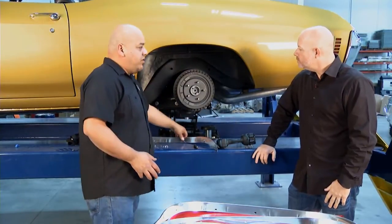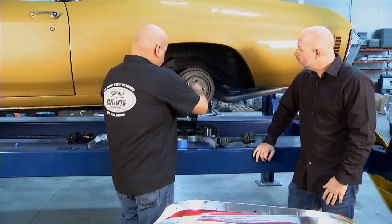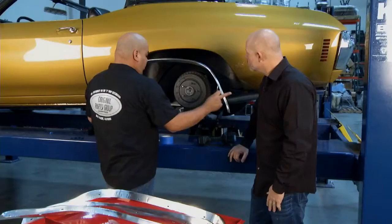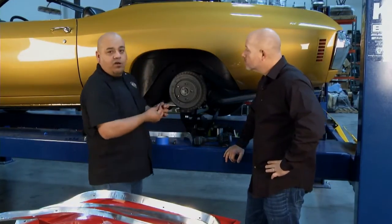First thing you want to do is protect the paint. So we're going to use tape. You want to mask your area and maybe a little bit on the molding itself just to keep it from scratching the aluminum against the paint. Second thing you want to do, I use a spring punch to mark the holes when you line up the molding against the body, so the drill bit itself doesn't walk. But you could also use a very small pilot drill bit.